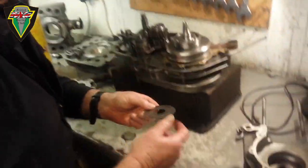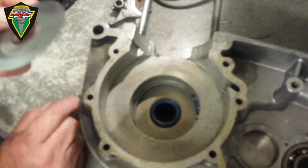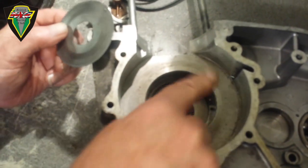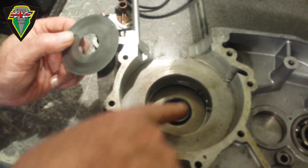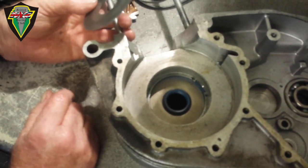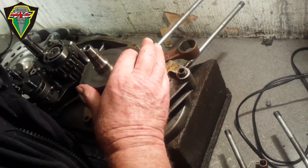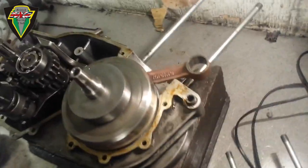The dimple has got to go upwards and has got to slot into that area there. So what I do is try and make it a point of alignment — we've got that cut-out there which is approximately the centre of the circlip gap. So I put this onto there with that aligned approximately into the centre of the gap, and that would probably be okay.